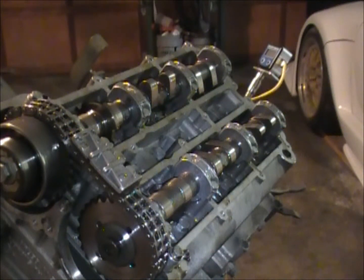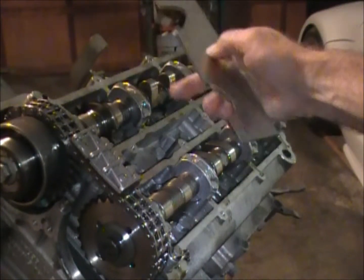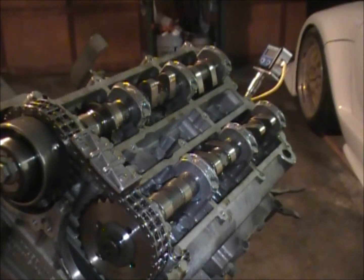On the 4-5-6 side, the first thing we want to do is make sure that the cams are roughed in properly. The best reference point is on the number 5 cam lobes. The factory has their plates that give a rough approximation of how they're supposed to look. It's hard to reference number 4 because they're pointed down when properly set up at overlap. Once the cams are roughed in, we're going to mount the apparatus and start to measure the cams.